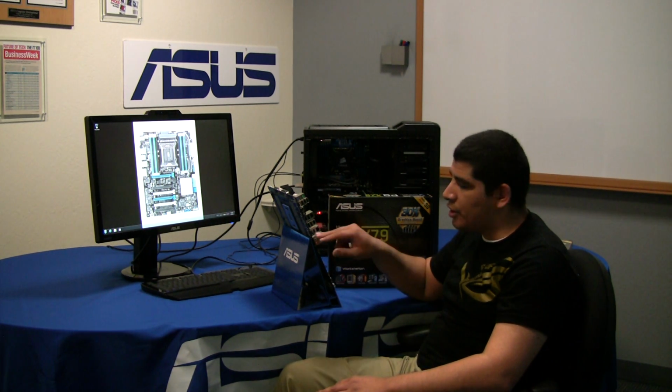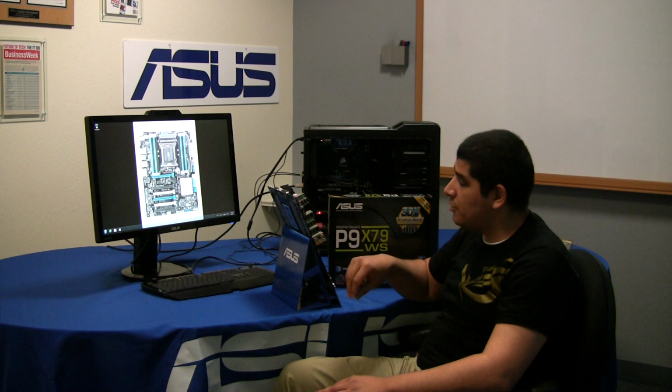Now with this option, we can transition into supporting SCSI operation mode, which is newer and more advanced than the standard BOT operation mode. SCSI, while not as advanced as the latest generation UASP mode, will still give you lower CPU utilization, higher throughput, and offers some queuing functionality as well. This overall helps extend the performance for either a standard USB 2 or a USB 3 device. Where things get really interesting though is if you have a UASP USB 3 device. These devices can see significant performance increases, sometimes extending performance over 100 megabytes on read and write performance, when you match that up with our USB 3 Boost ports. So definitely a pretty cool option in terms of extending the performance for USB 3 or USB 2 devices.